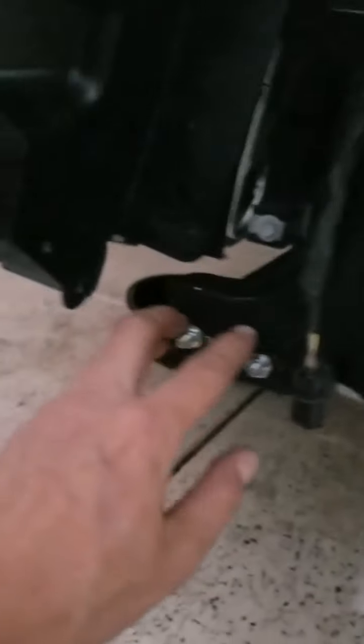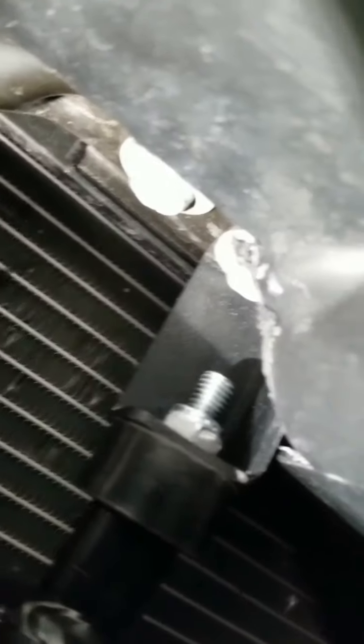I got all the bolts tight down here, went ahead and put the bolts in, tightened up the nuts on the brackets, and fitted this plastic piece. I had to retrim it a little bit more to go around there, but it's all good — this is all going to be behind the bumper anyway, so I'm not too worried about how it looks; it's more functional.